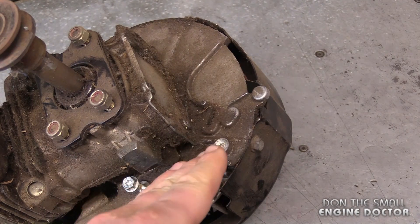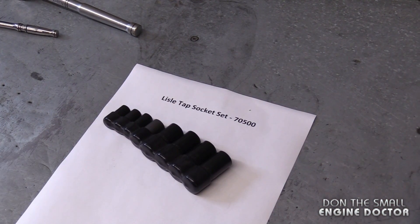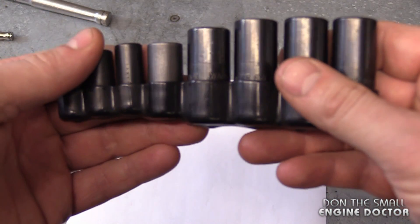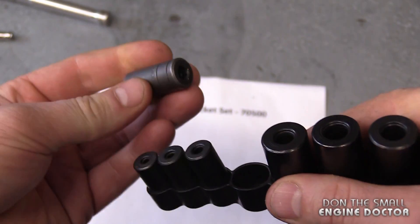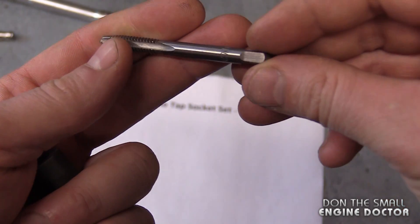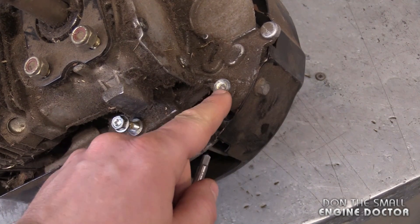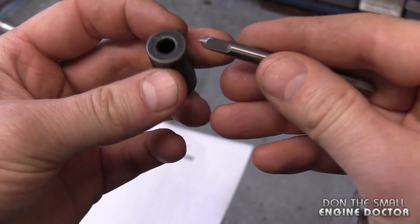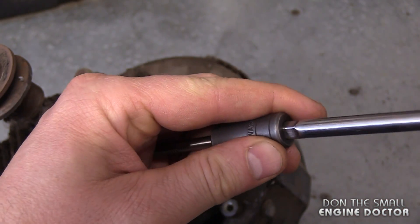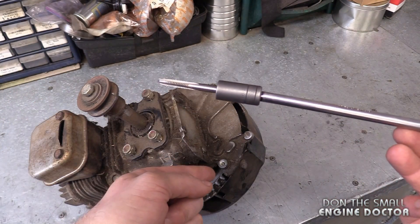Coming back to this job over here, I'm going to show you exactly what to do to use these to re-thread those threads. First of all, grab your set — you'll have to find the socket that fits perfectly in the tap that you want to use. This is actually the most common one I use for small engine repair. What I've got here is a quarter inch tap by 20NC, a very common tap for repairing threaded holes for starters. When you use the tap, just insert it into the socket and you'll need a quarter inch ratchet or extension. With a quarter inch ratchet, the extension, the socket, and the tap, you're all set up to fix those threads.